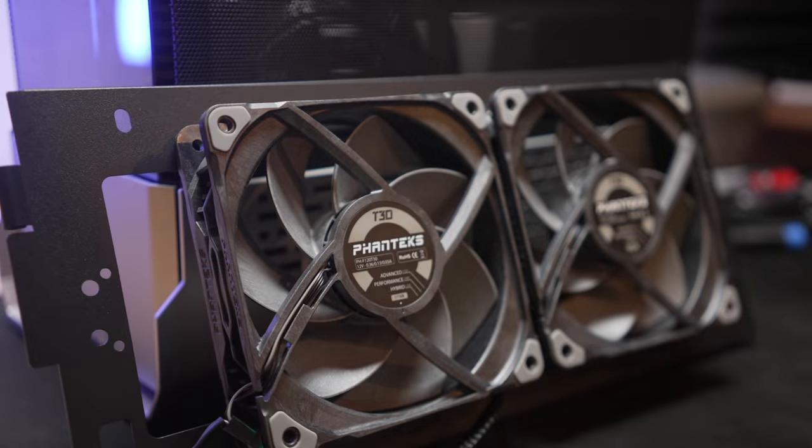The air cooler is taking advantage of a more direct airflow path compared to the one that the rad fans would have to take — through the side panel and then in and out through the top. I've only tested a similar setup with the Q58 from Lian Li, and it's pretty comparable, though the Shift XT does run a little bit behind — and that's considering the Q58 was using a weaker slim fan. The Shift XT has a pretty generous amount of clearance for an air cooler. At the 72 millimeter height you could go with low-profile coolers using slim fans such as the Noctua NH-L12S or the Scythe Big Shuriken 3, or piece together your own combo with a 25 millimeter fan.